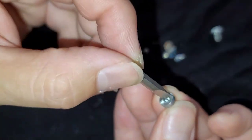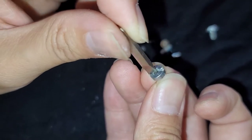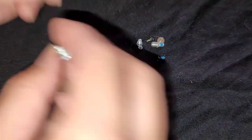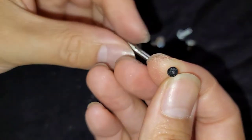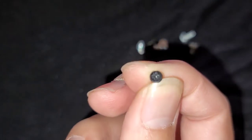So here you see the same exact one. Now you can get a flathead, but here you can see the flathead is a little bit too short — you don't want to use this because if you have this loose fit, that's where you end up breaking things. There are so many different types of screws — the head is not always matching with what you expect, and you can't go based off what other people use because they might have swapped the screws. So you see this one again — another cross, just see what fits. This fits really well, tight fit, holds on well. Using the wrong smaller one, it's very wobbly in the socket. You don't want that — make sure it's a tight fit.